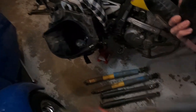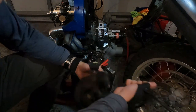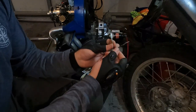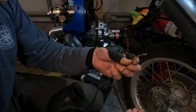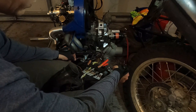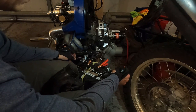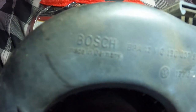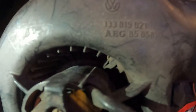All right, now finally got the old one out. Still got a lot of work to do, but got this one out. So this is just a test I'm going to do before I put this new fan in the Bug — basically you've got your two speed wires right here. These are two different speeds, high and low, you'll be able to tell pretty quick, and then your ground or negative. Now after I tested this one, it's not working at all, the fan's not spinning, and it's also kind of hard to spin. If someone knows the difference — this is a Bosch fan and it looks like this is AEG. It is interesting that these are the same VW part number, but I'm going to look up and see if there's a difference in why the Bosch was put in some and the AEG in the others.